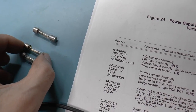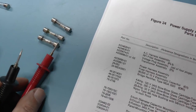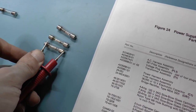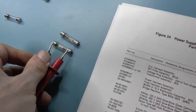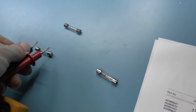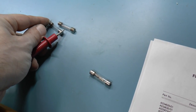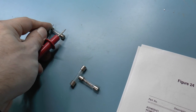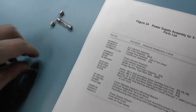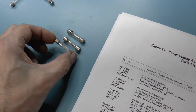So I might just replace that one. These look really original. I'm just going to make sure that these fuses are okay with my continuity tester. All these fuses are good. But I'll probably just end up replacing these 4 amp ones, because one of them looks a little bit skeezy.